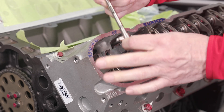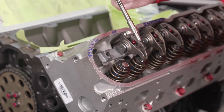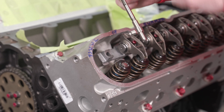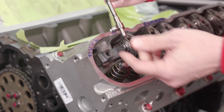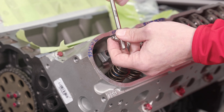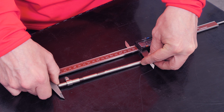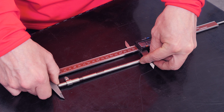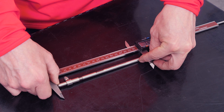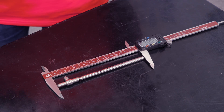Tool is out. This is now perfect - it captures zero lash length, without the lifter preload which gets mathematically added afterward. It's not loose, not sloppy - it is perfect. Let's head over to the table and measure it up.